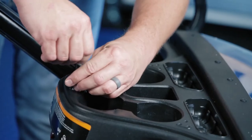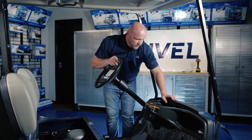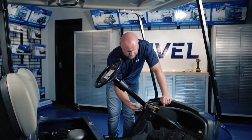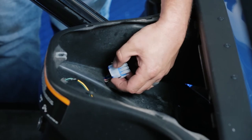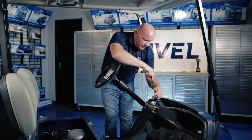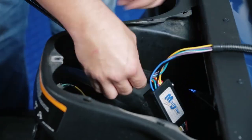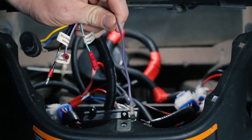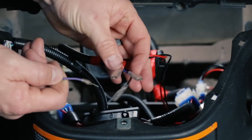Then we're going to take the set screw out of the top of our cup holder and retain the screw. Pop the cup holder out. Now we're going to take a cutting tool and cut a hole in the bottom side of our access panel here that's big enough to fit our 12 pin connector up through the bottom. We're going to pull the 12 pin through the access and then reach into the front area and pull up our harness. At this point, this is all we should have left of our front harness. You'll have your 12 pin that goes to the 12 pin connector here — we'll go ahead and plug that in. Now we're going to attach the purple wire from our turn signal harness to the blue wire of our main harness.